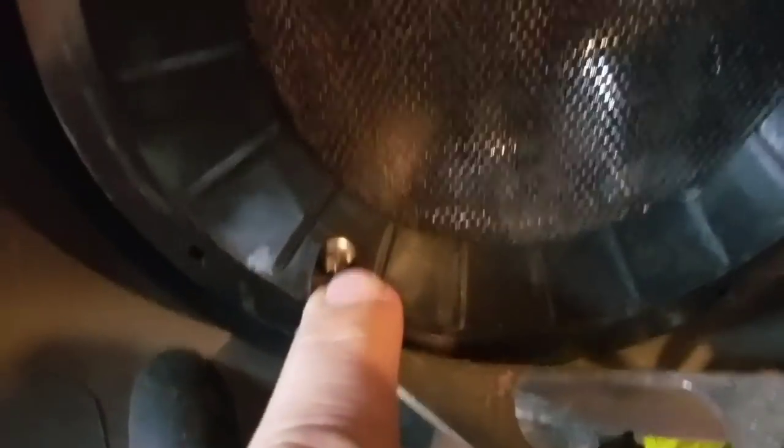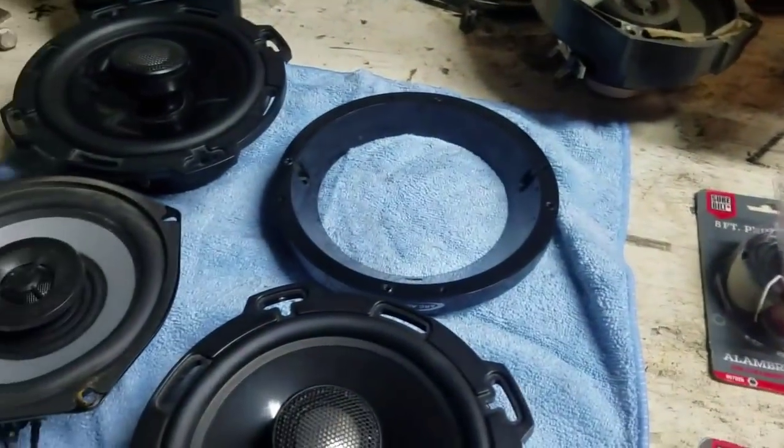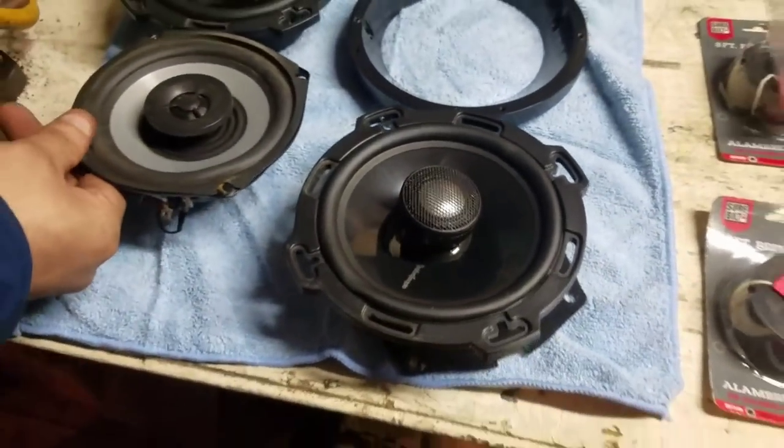I'll find links for everything in the description. These are pretty much this exact brand on Amazon — about 40 bucks or a little less. You're going to put your Torx screws down here and your two Phillips up here. This bracket is going to screw into the plastic — the speaker will sit here, the bracket goes from here and we'll put a screw into it. You pull the bracket back just a little bit and slip the speaker in between it, but you need to keep that felt on.